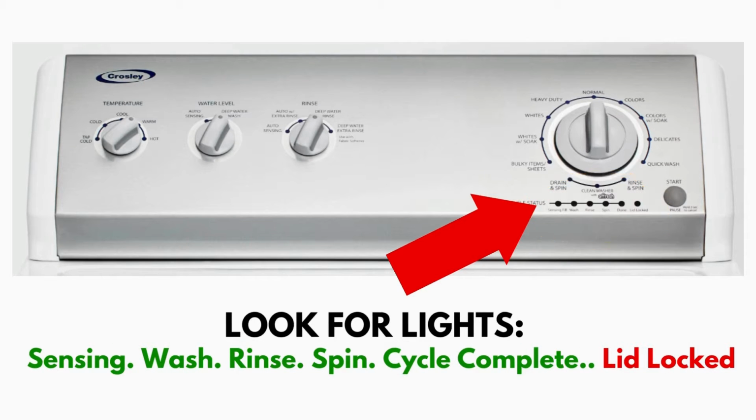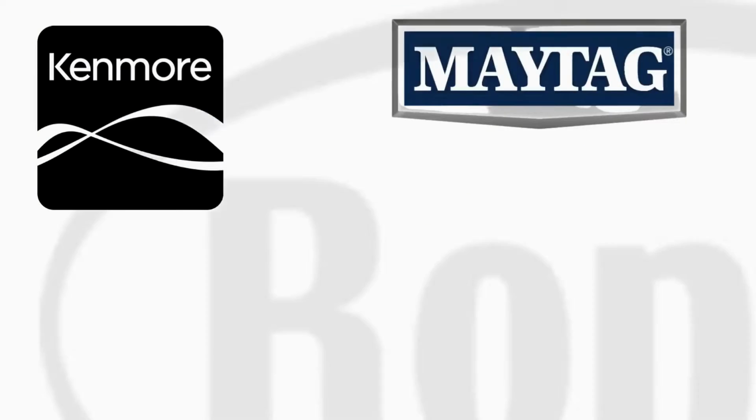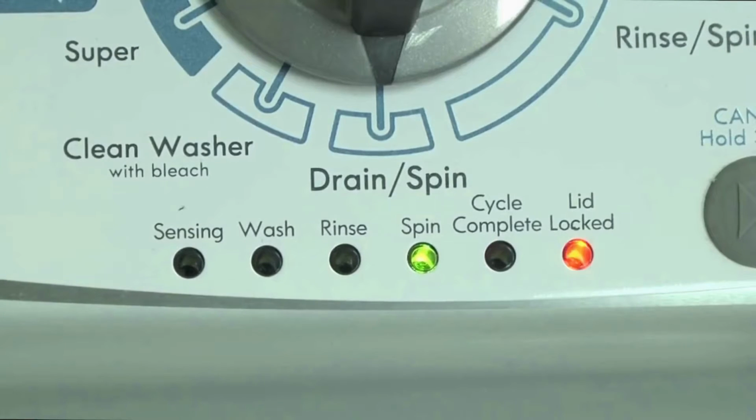This type of washer is called a vertical modular washer, VMW, for short, which is the most sold washer in America and is sold by many different brands such as Kenmore, Maytag, Roper, Amana, Whirlpool and many others. The best way to recognize these washers is by the lights on the panel. These washers have a built-in self-diagnosing system that can tell you exactly what's wrong with the machine.